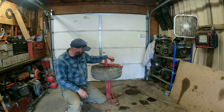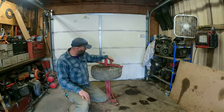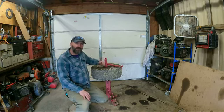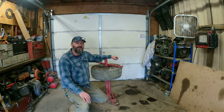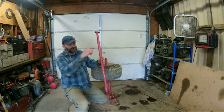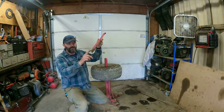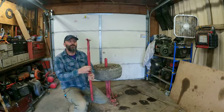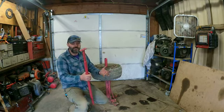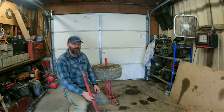I'm gonna put these tires on today on these rims, and I noticed - and I'm not saying anything against him, him and I have talked about it - he ripped the tire off like he normally would, and then when he went to put it on, he cranked it down tight and then started with screwdrivers and tire spoons to put the tire back on. Which I thought was strange, because this bar that comes with it - everybody knows how to break the bead, this end breaks the bead and pulls the tire off - but this other end is the end you use to put it back on, and it didn't seem as though he knew that, and I told him I would make a video.